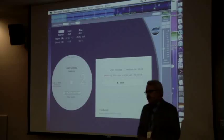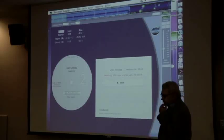Any other questions? Yes? To be clear, this analog converter that you're using up there, it's an RME, the Babyface, yes. And it has a line level preamp, not the RIAA equalization. Correct. The inputs are configurable to line level input. So if you really want, you can use your own phonostage, but you'll have the ability here to connect the turntable directly and do your own comparison. And I've never heard of anybody going back to their phonostage.